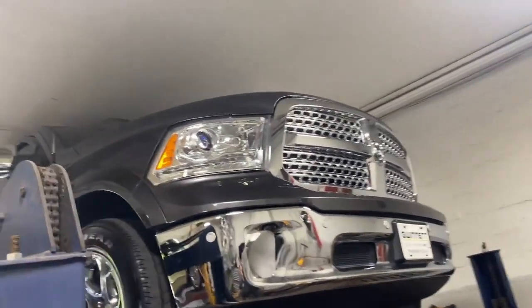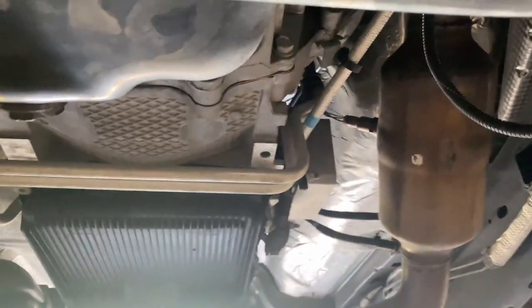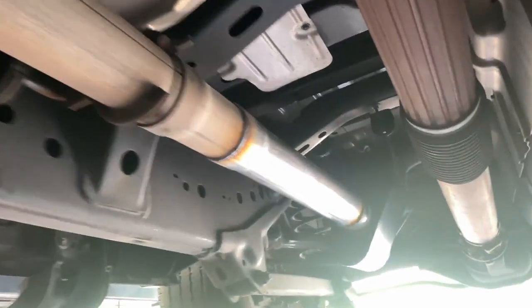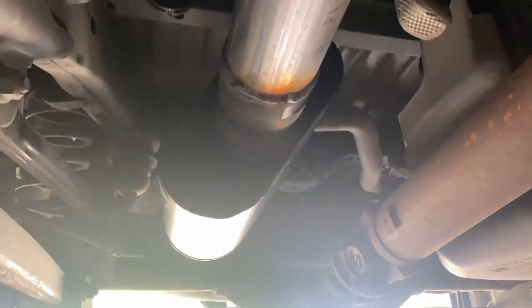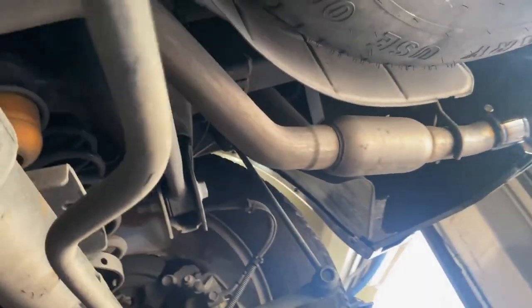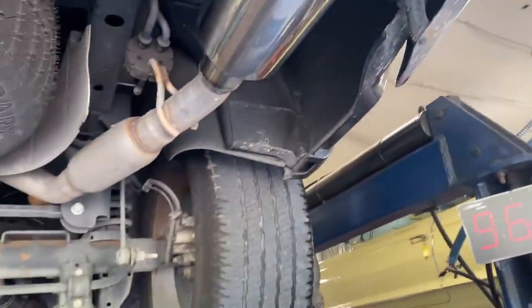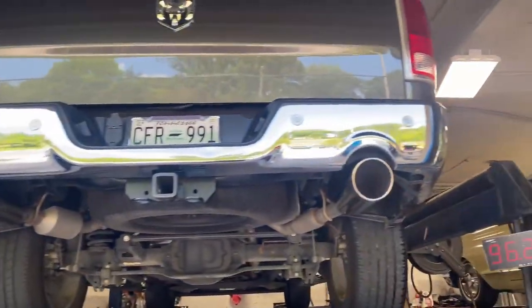Ram 1500 5.7 liter Hemi. Beautiful truck. Still got factory converters there and there. Then it winds into a single 3-inch all the way back, and we continued the 3-inch there into a 3-inch to 2.5 Flowmaster. The link will be in the description. It's a Super 10, and then it's got 2.25 tailpipes on each side, factory. And we added 5-inch roll tips there and there to complete the look.